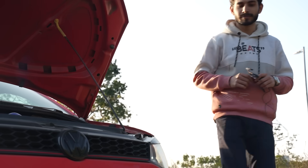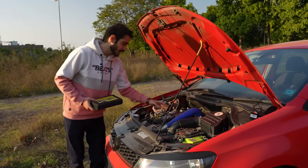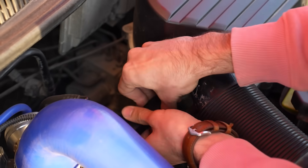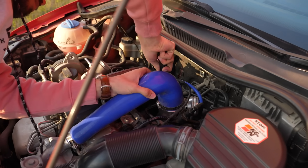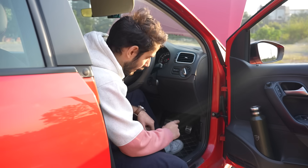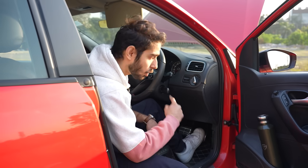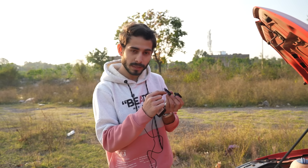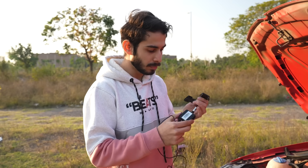Let's see how it does that. Let me show you what the throttle body is exactly, where it is, and how it works. This is the throttle body right here and this inside is its butterfly valve. Anytime I put any throttle, it will open that butterfly valve. Now let's install this throttle commander and discuss a little bit more about it. It has two plugs — the original socket from your throttle pedal gets inserted right here, and this socket from the throttle commander goes to your throttle pedal. So the wire coming from the interior harness goes here and this new wire goes into the throttle pedal. This basically becomes the middle agent which influences the reaction of the throttle body.